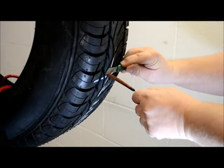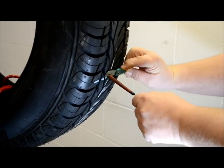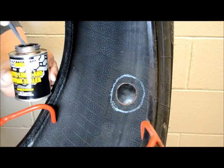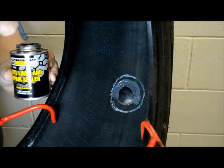Without stretching the plug, cut off the excess at the tread line. Apply Western Weld RS8 or RS32 inner liner sealer, covering the entire buffed area as well as the edge of the repair.